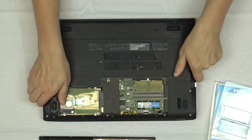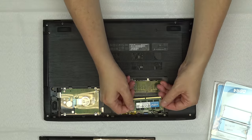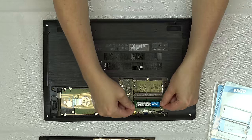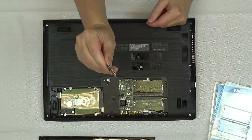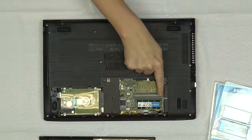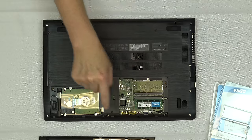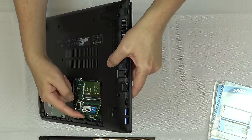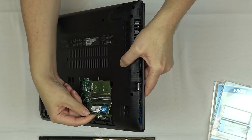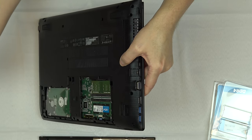Please note: when this gets inserted — and I'll show this to you a couple of times to make sure it's absolutely clear — these golden fingers, when I insert the memory at an angle — about a 30 degree angle, not flat, not straight up and down — you'll see how the golden fingers are completely obscured and covered by the black plastic slot, but the memory is not yet installed. If I tilt it up, you'll see it's still up, and it will rest like that. As I push it in, it just sets like that, and then clicks into place.